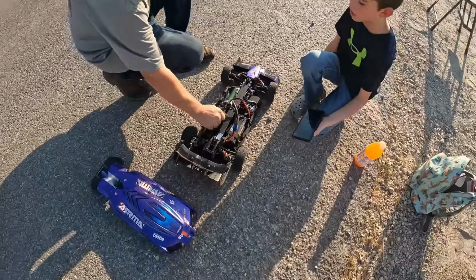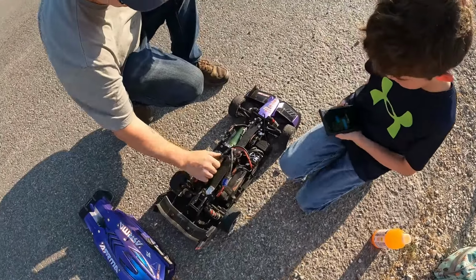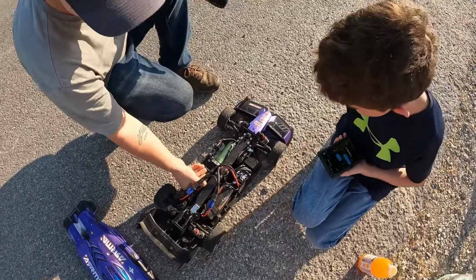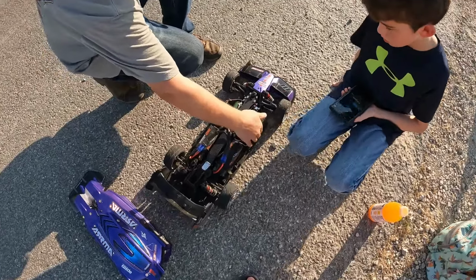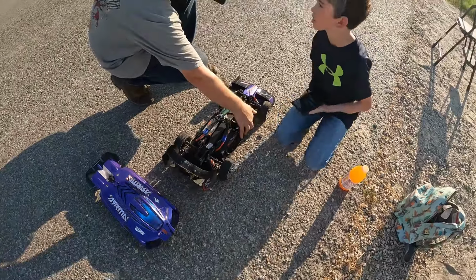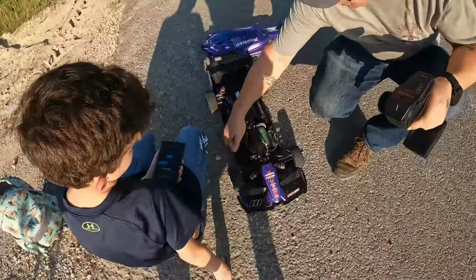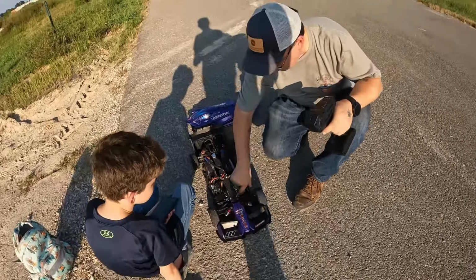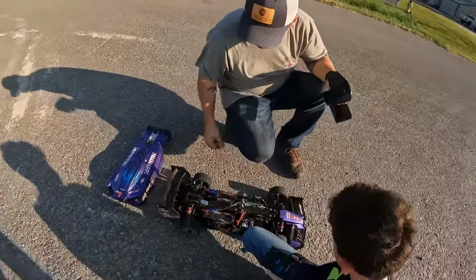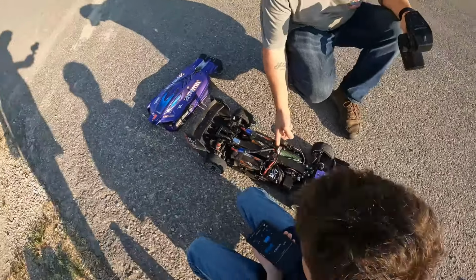Is it on 100%? Yeah. Okay. So the connectors are cool. The batteries are a little warm. Wires are cool. The ESC is totally cool. The ESC doesn't even care what we're doing. Let's do two more runs to see if we can try getting a little higher. I have to let it cool in between runs, because right now I'm afraid to overheat the motor.